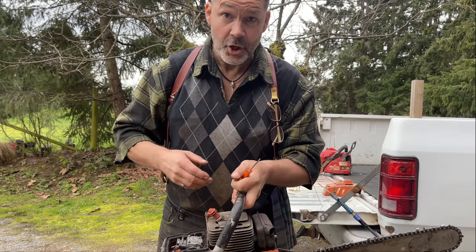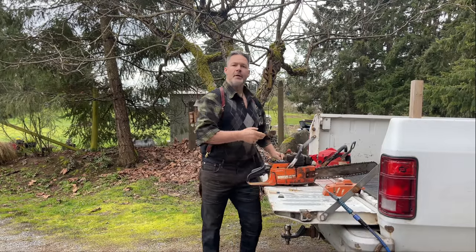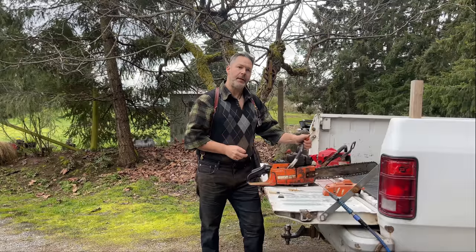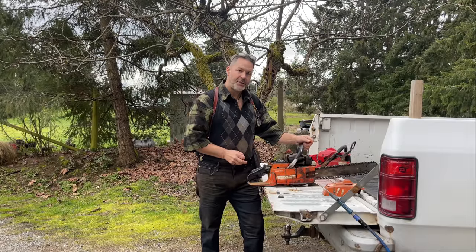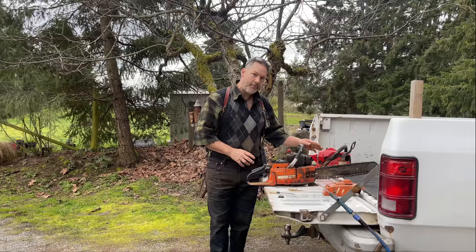That's a nice running saw, friends. Very nice running saw. These old Huskies are great. So I tuned it up for you a little bit. Morgan, I gave you a little bit more high jet, just a touch. And once you tighten that chain up,